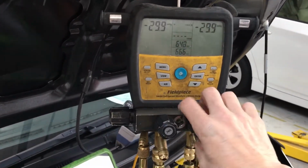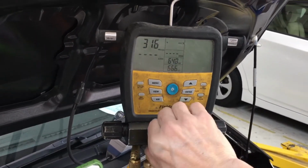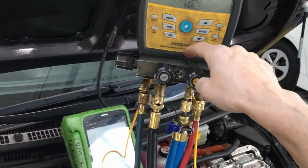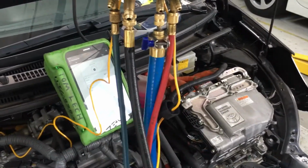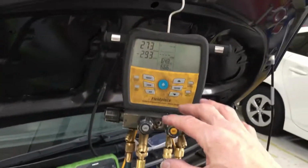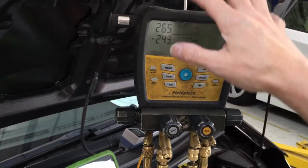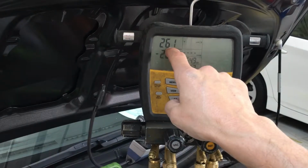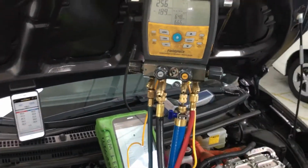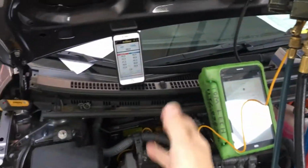So right now we just opened up to the system itself, and as you can see, we're already at 300 microns. We're at 300 microns at this point where the sensor is, and in these hoses, because these hoses are not open to the system. So I just proved, at least with my pumps running, my gauge can go to this level. So there's no reason once I open to a system I shouldn't be able to hit at least 500 microns if I have a clean dry system.